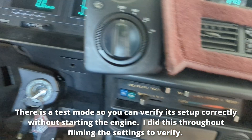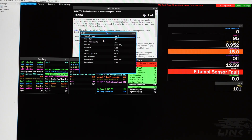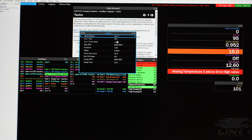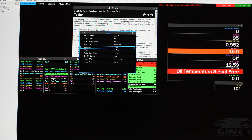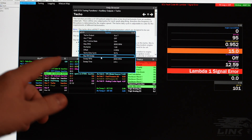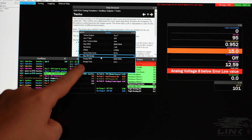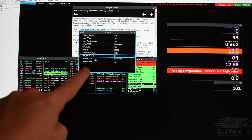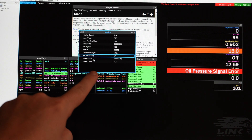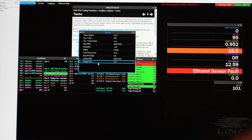We've got four cylinder selected and it's outputting 2000 RPM, so that's working how it should. In the Link ECU software for the tach output configuration, you can set the max RPM — the multiplier needs to be set to one. There's an offset so you can correct some RPM. Duty cycle and some other settings are adjustable too. The key-on sweep is one of the features I think is super neat. When you turn the key it'll sweep the tachometer, which is awesome. I can set the sweep RPM up to 8,000 and set the sweep time — how long it takes to go up and back.